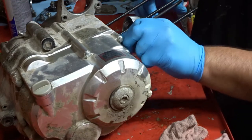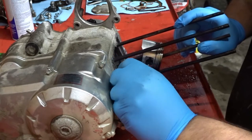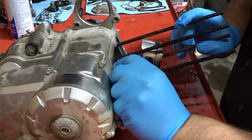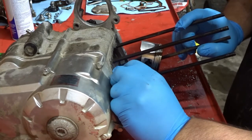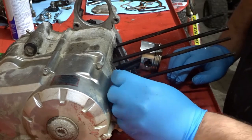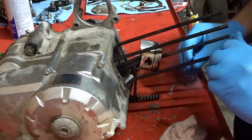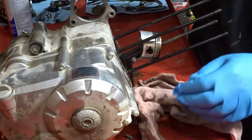What I'm doing here — and that's kind of hard to see with the angle — is cleaning the base gasket off the crankcase. The reason for it: when we put the new base gasket on, if that surface isn't 100% flat, you're going to have a base gasket leak, which will create all kinds of issues as far as an oil leak.